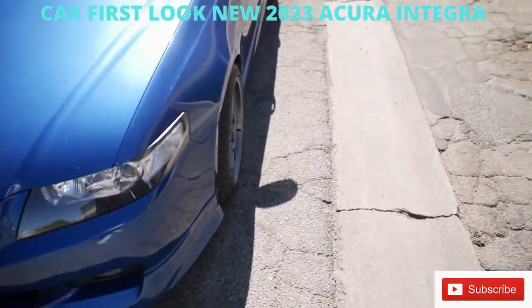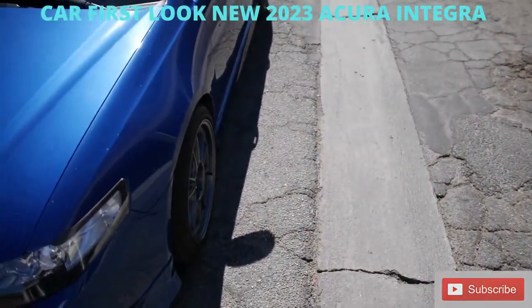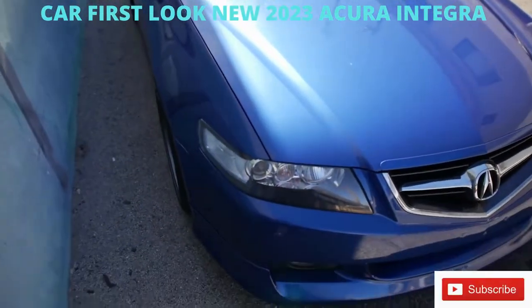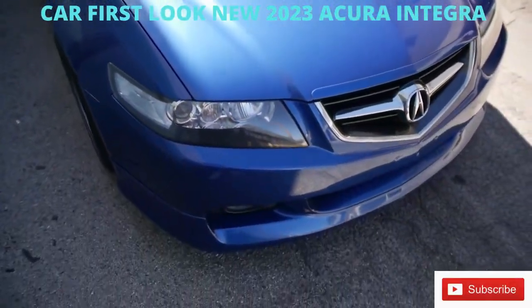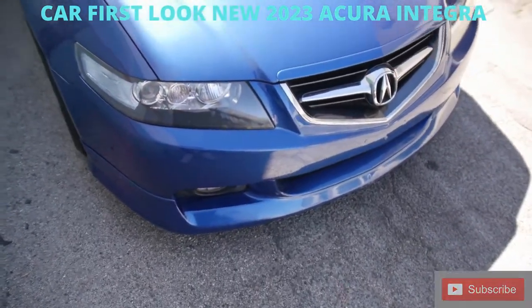If you straight lower it out of the box, you do need to roll the fenders because it's double wishbone, so the camber doesn't really adjust when you lower it. Double wishbone handles well, but for stance people it's not the best thing, obviously. So I had those rolled — car looks good in my opinion, it runs good, it drives well.